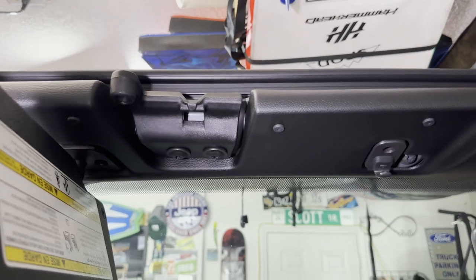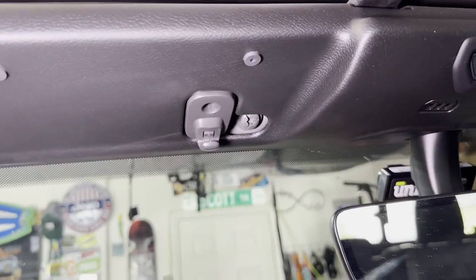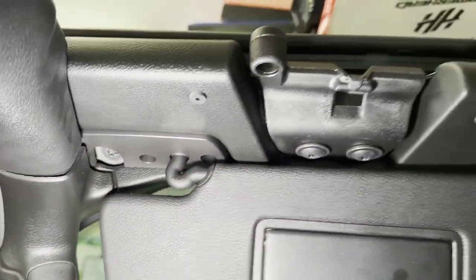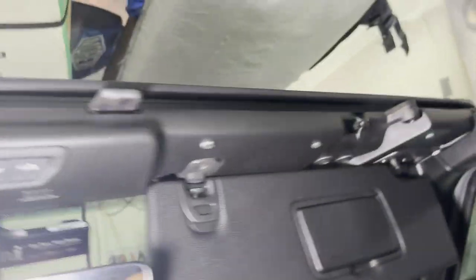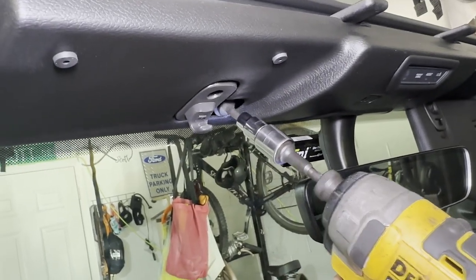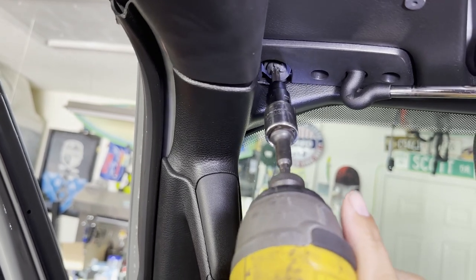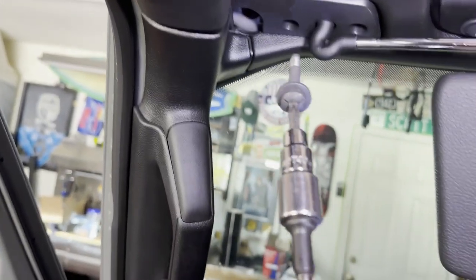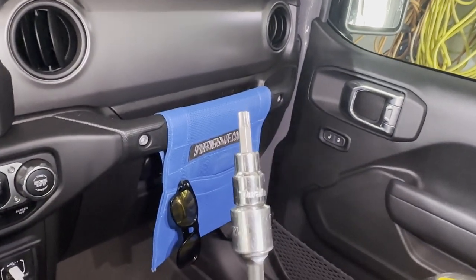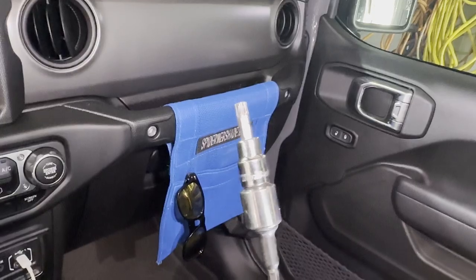Looking in here on the driver's side — you need to remove four bolts for the windshield, just to lower it slightly forward to get those clips on. This is one of the bolts and on this side is the other one, so we're going to take off these two on this side and the same two on that side. These are actually incredibly loose. I should mention these are T45 — different from the T25 you took out for your spider nubs — the windshield bolts are T45 and included in your Jeep kit.